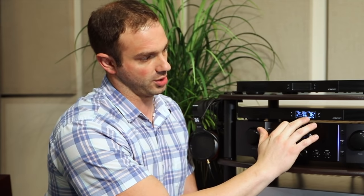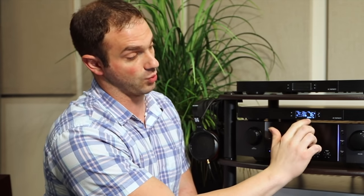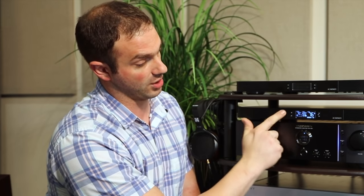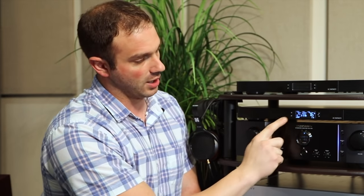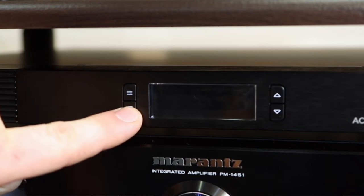It will not work when you go directly into the alarm mode — the alarm mode setting is just so you can set the temperature. Once you have set it in alarm mode, you have to push three buttons to go back to auto. The leaf button right here is just so you can turn the LCD display off so you don't have to stare at it.